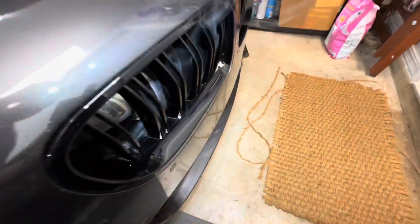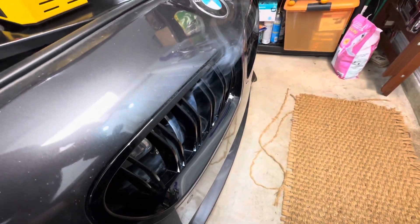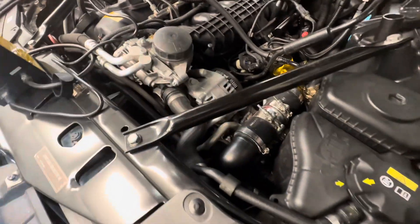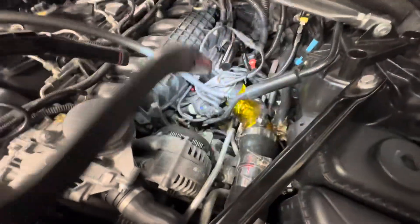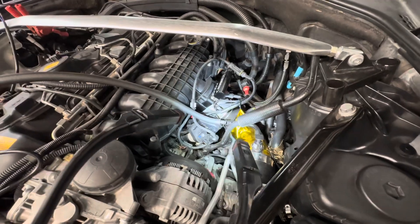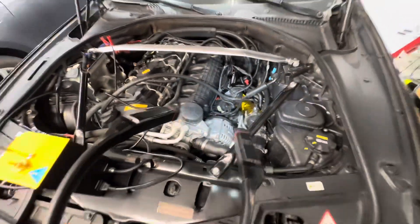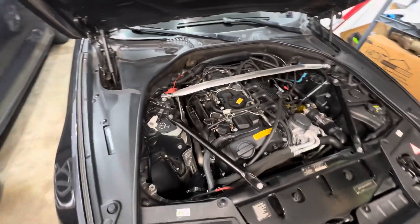There's also smoke coming out of the front at the air filter, but more importantly, where it's not coming out of is the bottom where it connects to the intercooler, and also on this side. All this stuff is residual coming out of the air filter, and there is no smoke coming out of the throttle body and the fogger area, which is where I was concerned about. So I'm happy.